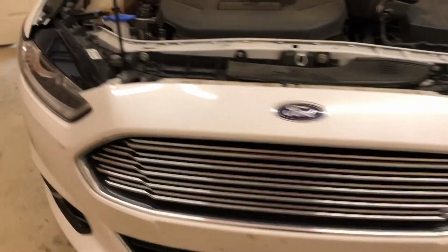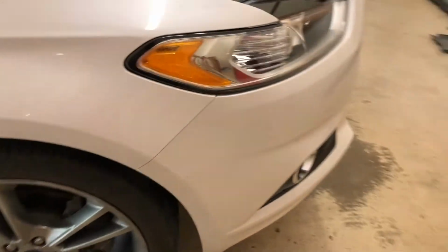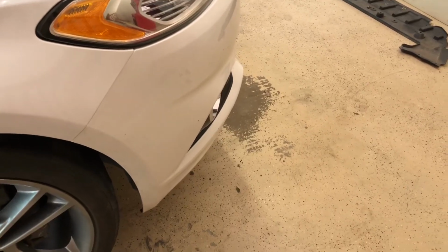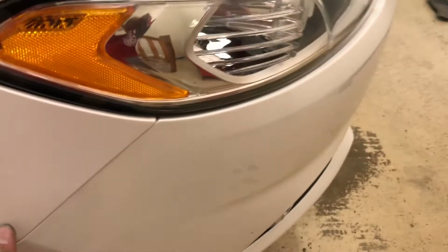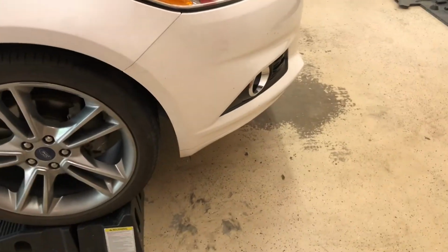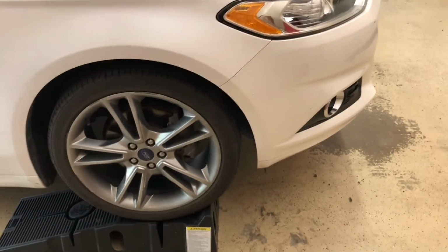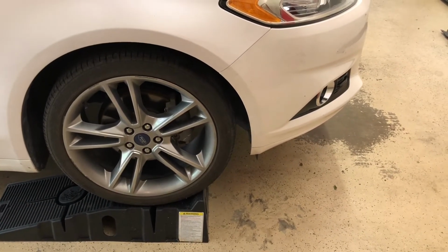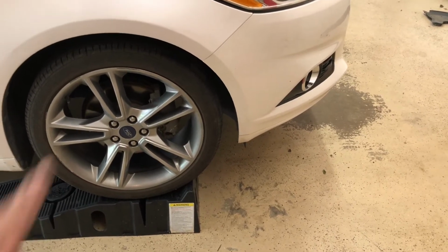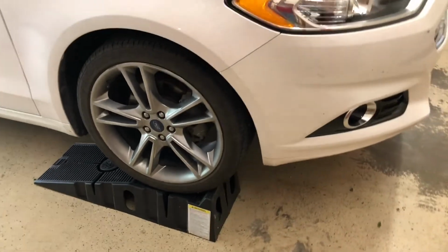I've not put any of these bolts back on yet, but this side is really the pain just because of the windshield washer fluid tank. And I've got it back in there, but if I do this again, I'm gonna pull this car up on the ramps, jack this side up and put it on a jack stand and pull that front tire off and pull this whole inner fender well out of it. It would just be easier.